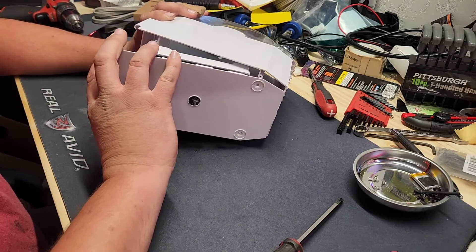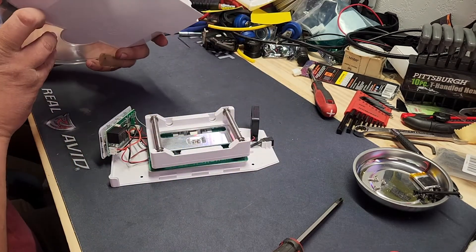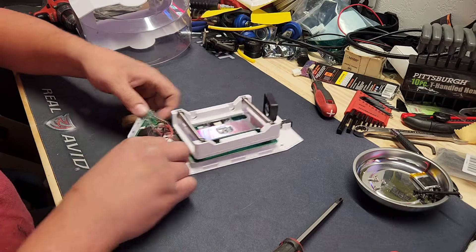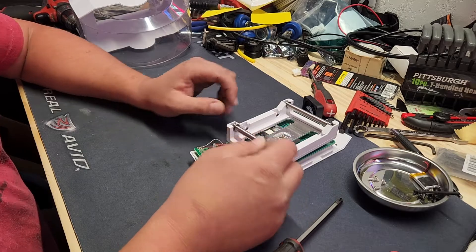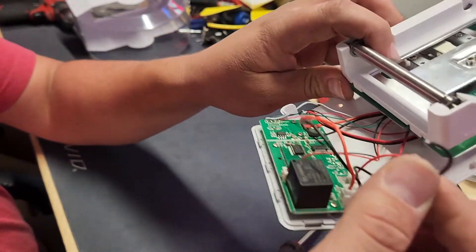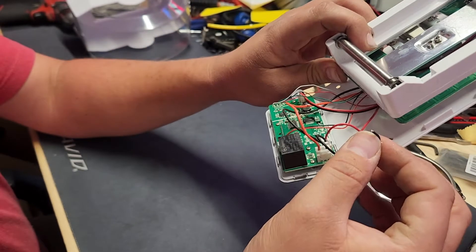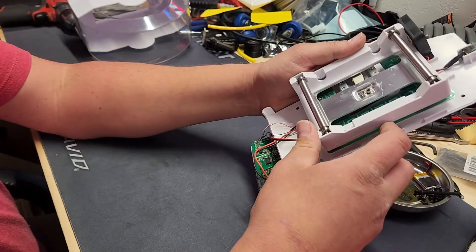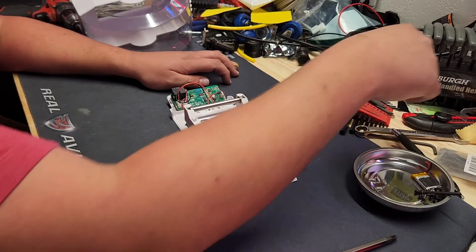Doesn't look like it comes out the sides — I think it all comes out the bottom. We've got a fan, here's a slide — slides right in there. There's the housing. So this thing is powered off of 12 volts DC, and from the looks of it here, we just have a little relay. Spotted it. Well, that seems like a pretty easy fix. I'm guessing this goes to the power that feeds this little resistive heater grid on this aluminum plate down here. That was a pretty easy root cause — let's try to get her fixed.